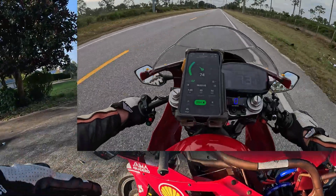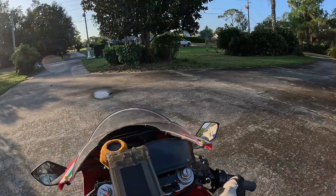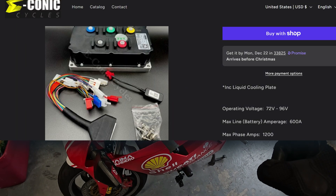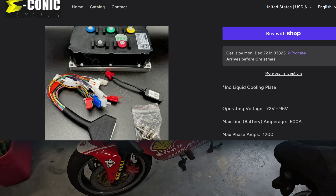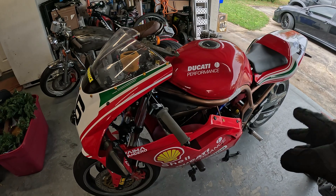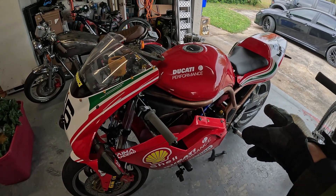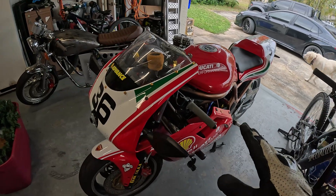My DKD displays are dead balls accurate, backed up by GPS. I had an ND96 1200 controller in here — just wasn't putting out the power down low that I liked. Doing the ratios and speed test, I ran into an RPM problem with the testing, so I wanted to get the RPMs lower. I put a smaller sprocket in the back to bring those RPMs way up higher so I wasn't even messing with that RPM limit while I was doing my testing.